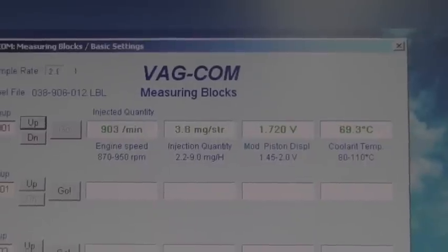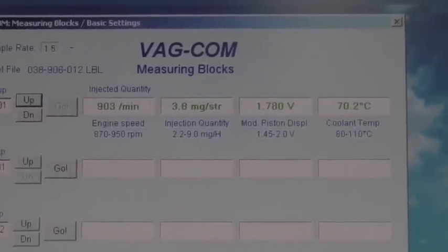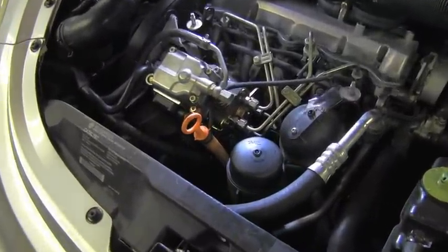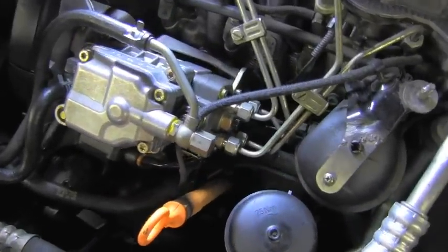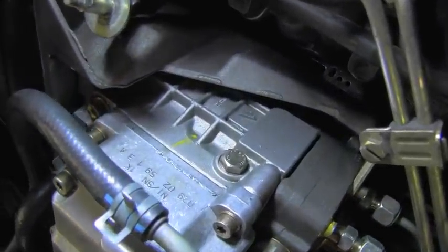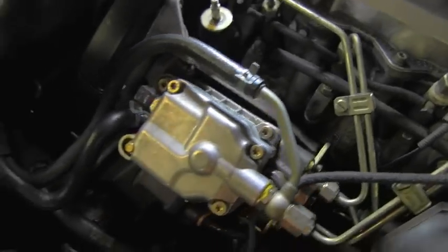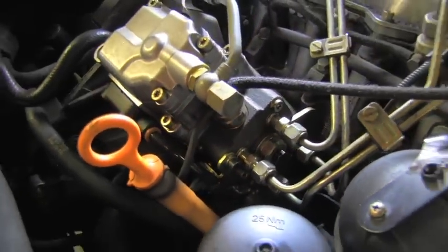It's time to tighten the bolts. After tightening the bolts it changes a little bit, but it's still very nicely between 2.2 and 9 milligrams per stroke. I'm satisfied with these numbers and will permanently tighten all the bolts. I let the engine run until it got really warm and I'm very happy with the results of this repair. I now have a perfectly dry injection pump — this is the area where it was leaking and now it's perfectly dry. I don't smell fuel anymore.